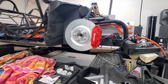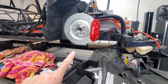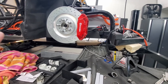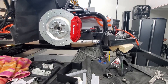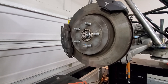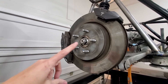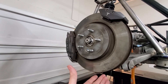One other thing we need to be thinking about is getting some wheels. I haven't really decided on rims yet, but the front is 5x100 for the lug spacing. I can fit an 18-inch rim, and I think I'll go 9 or 9.5 wide up front — that'll be plenty for this light car. The rear for the Tesla is 5x120, so much bigger bolt pattern. I can't fit an 18 on there — it's too small, it'll hit the calipers — so I'm going to do 19 on the rear, and I believe 11 wide.